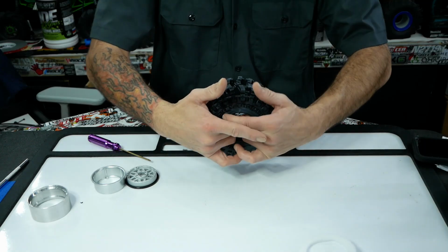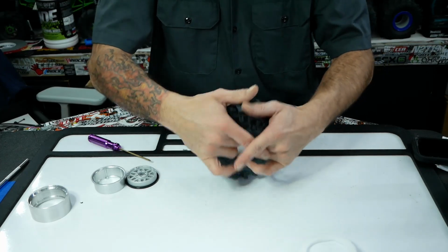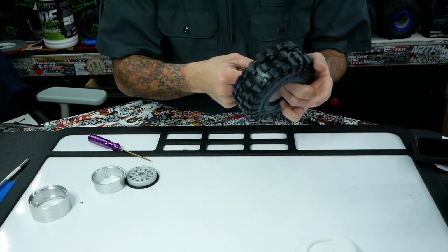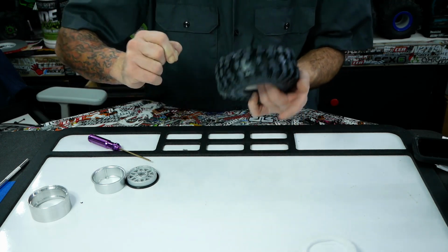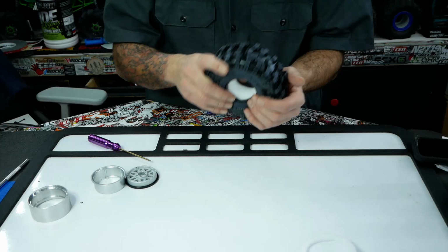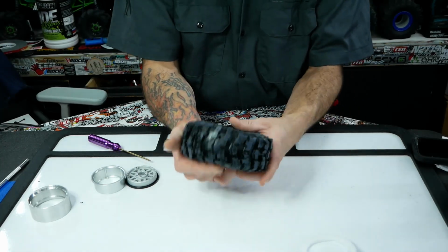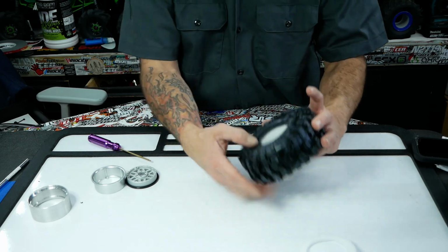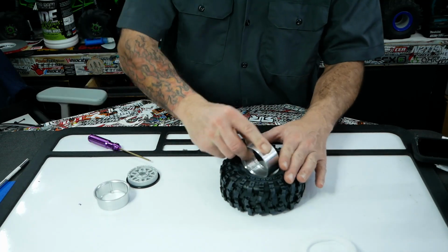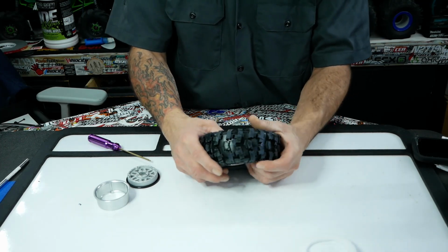When you put the foam in, you pull the foam, get it sitting in the tire. So we bevel cut the foam like we do on all of them, so the tire doesn't pinch the two halves coming together. Drop them in, rotate, right? Bloop, bloop, done. Easy.